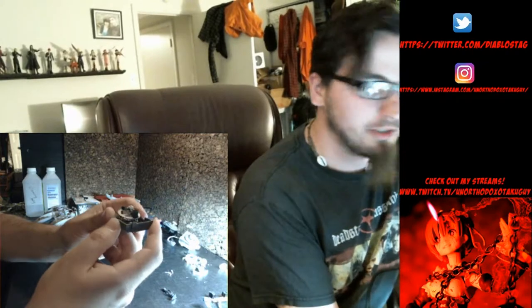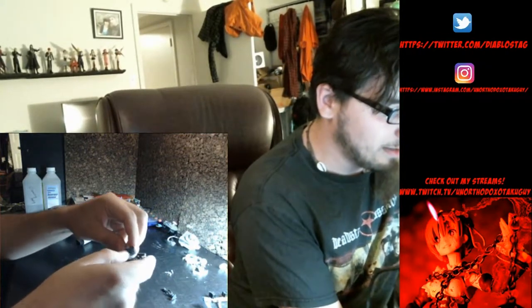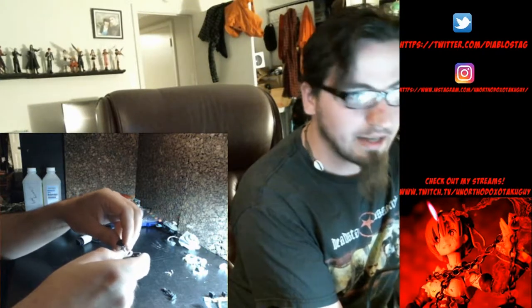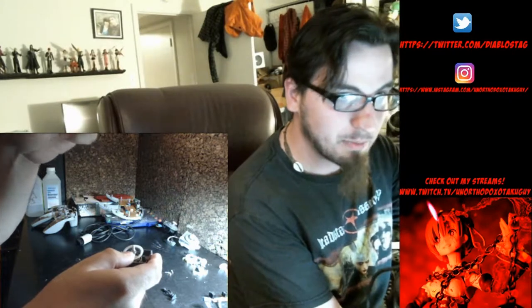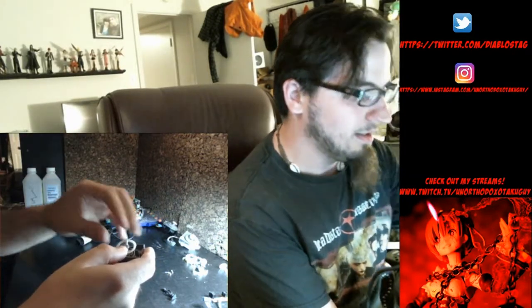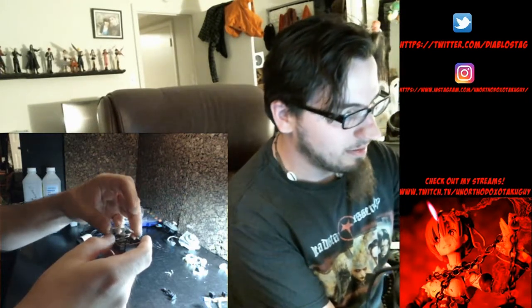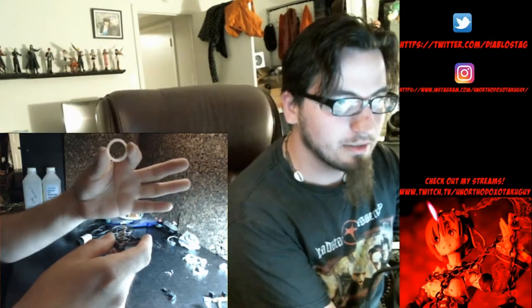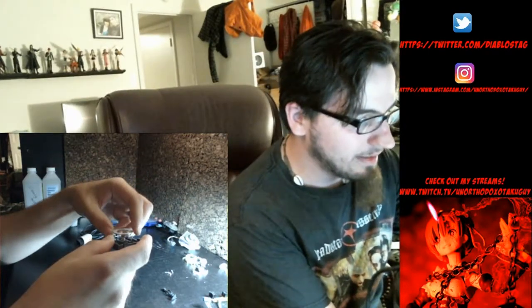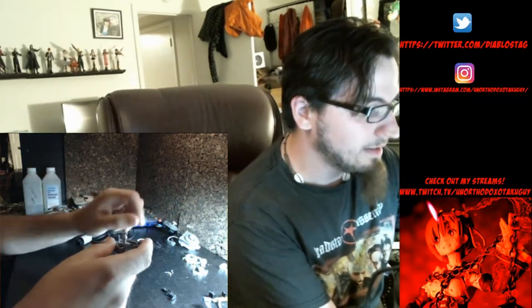So now we have this keyed control stick that wants to explode. It's under spring pressure. It's a big spring. So you want to push down on the spring and unlock the keyway by taking the one black gear off. This is the small gear, the small gear is upper. And now the spring can release, and you take it out. Before this all comes apart, remember how this goes. There's a little plastic washer that is slotted that will sit on top of the spring. So the best thing to do is lift it off and put it off to the side, because it's going to sit there.